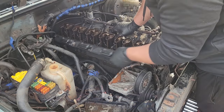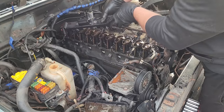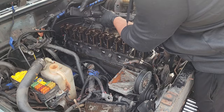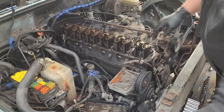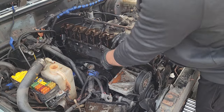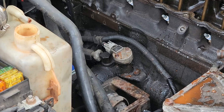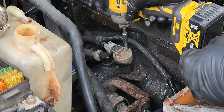Should just slide off. Go, all the plugs. And we got a clip over here, safety clip. Push and pull. All right, got the coil pack ignition system. Oh, and hey, definitely gonna want this camshaft sensor. Had to swap to a 7/32 because these are small and weird.